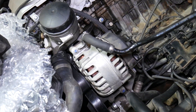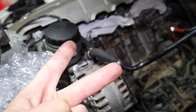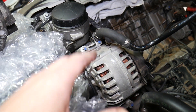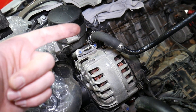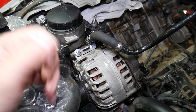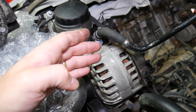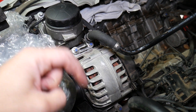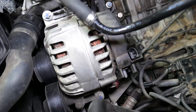Step number one: you need to disconnect the car battery on your BMW X1. Most of you probably know how to do that, but if you don't, it really matters which terminal you disconnect first — positive or negative — and which one you reconnect. If you do it the wrong way, you can cause damage to the electrical system, components, modules, and the car computer. Always follow the right procedure. We'll have a video linked in the description below.